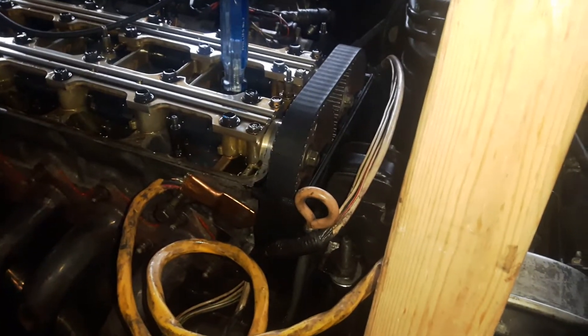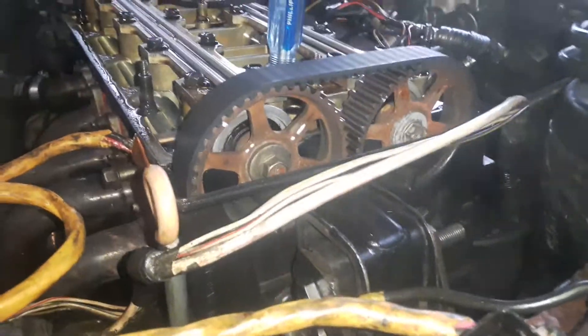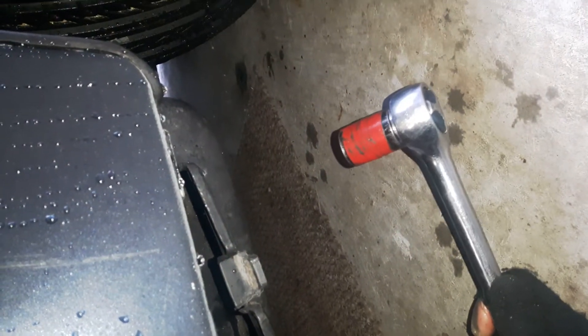In Honda terms, the Honda engine turns counterclockwise, so this is number one. Use — I think it's a 17, 18, or 19 millimeter socket, something like that, maybe 18 millimeter. I'll be turning the engine with this; it's a lot easier. I can crank it almost to the top then use this one for minor adjustment.